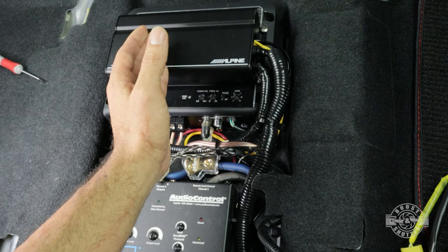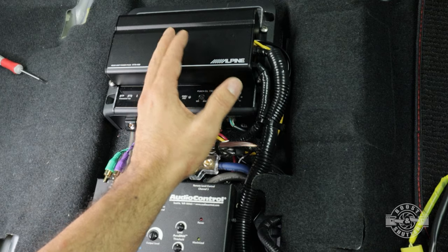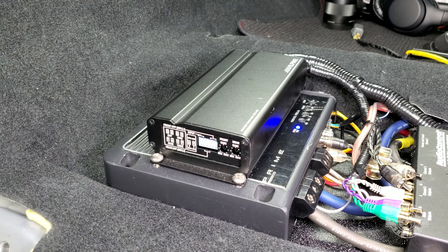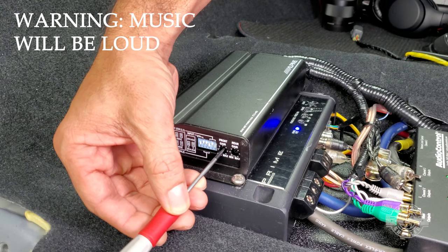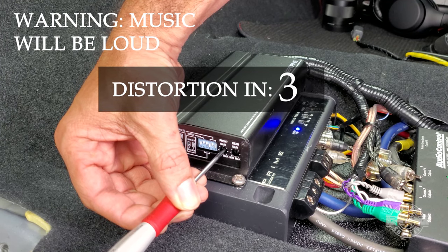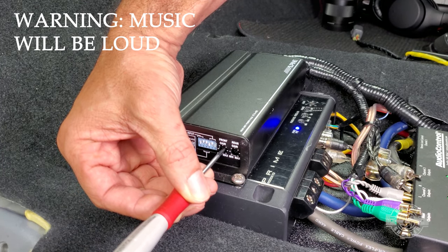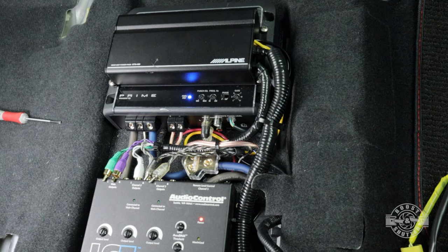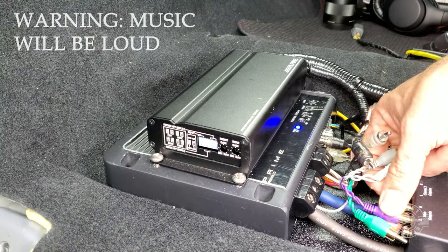The first step is turning up the volume on your head unit until you hear distortion, then backing off until the distortion goes away. In some head units you could actually max out the volume before you hear distortion. I'm going to turn up the music — it's probably going to get a little loud for a split second — then turn up the gain on the amplifier while the music is up until I hear distortion, and then back it away. I could definitely hear the distortion when I turned the gain too high, so I went ahead and backed it up. My front channels are good — I'm going to do the same thing with the rear channels now.